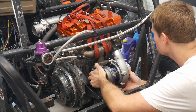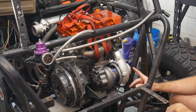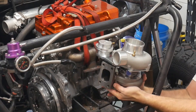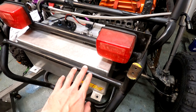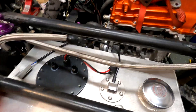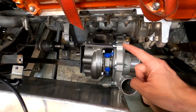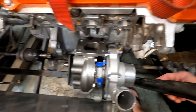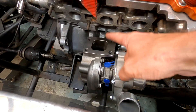This is so bad. The intake of this turbo is right in line with this guy - this is what I have been most concerned about. It would look really cool right up on top of the engine. With the fuel tank moved back about an inch, I could extend these arms underneath to have the fuel tank further back - that is doable. But the clearance here and up there is the problem. The internal wastegate actuator becomes a really difficult problem to solve.